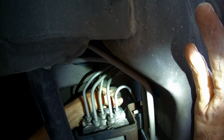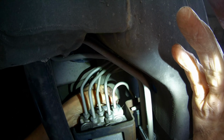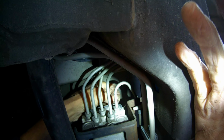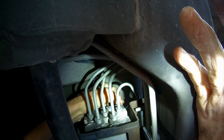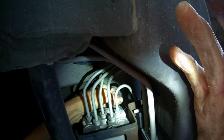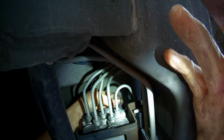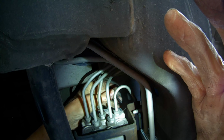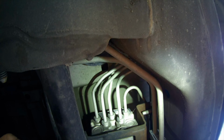We get this thing out. You just have to take off the top. It has a sealed top that'll expose the circuit board, and then we can resolder probably 8 joints. We're just going to use some flux on them first. We'll get them hot with our soldering iron and then add a little extra solder. And then that's screw number 3. And then we'll clean up the flux and put it all back together. Reseal the top.